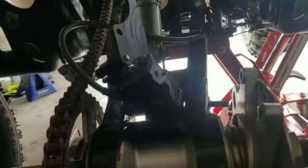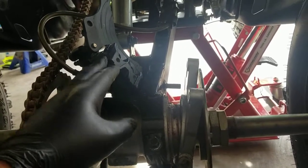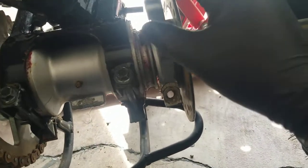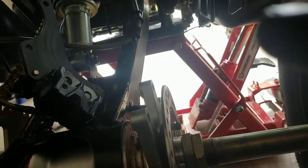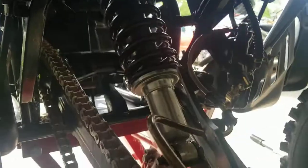You can tell I don't have my wheel tensioner — the spring tensioner — up here yet, but you can see that's a lot of slack on that chain. This is just after basically two rides and the chain came completely loose. So after we remove the caliper and the bracket, we remove the differential bracket that holds it in place so it doesn't rotate while you're riding. Remove that out of the way, loosen up the two rear bolts, and we're able to now rotate the differential.